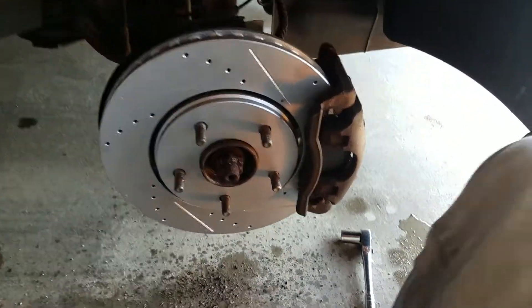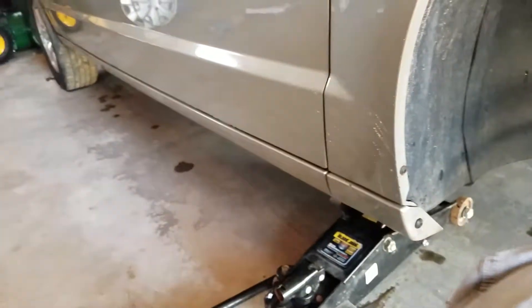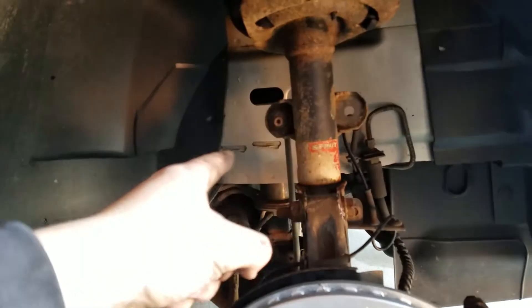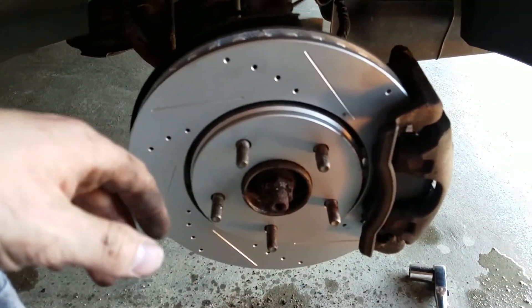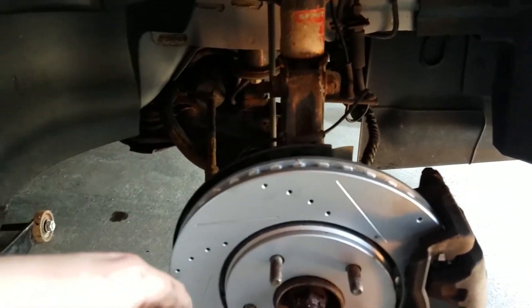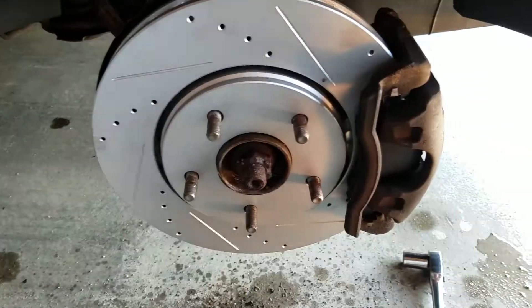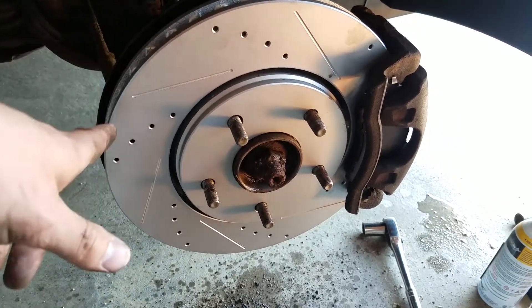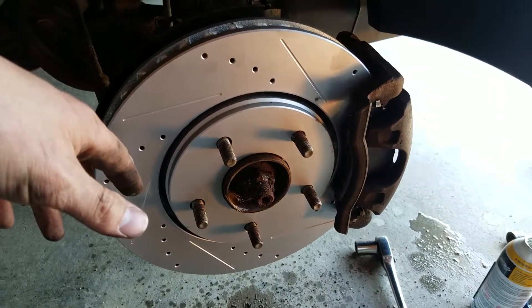Here we have the finished product — the tire isn't on yet. I just gotta pump the brakes and make sure this is good to go. I just bled them up. Normally you start with the rear passenger side so you get all that dirty fluid out toward the back, since the master cylinder is up there on the driver side — you want it as far away as possible to get the dirty fluid out. This isn't exactly a 'how-to' tutorial video; I just wanted to quick show these rotors. These are ceramic pads — I'll put the link to these parts in the description below. I scored two drilled and slotted rotors front right and left, along with the ceramic pads, on Amazon for 90 bucks. I'll see how they hold up — the reviews are really good on them.